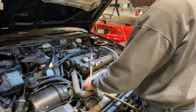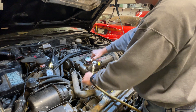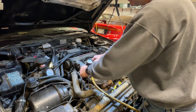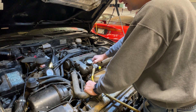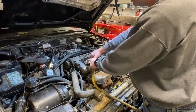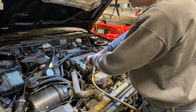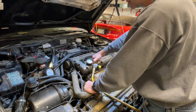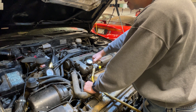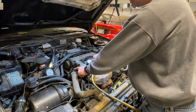Let's do the next one. If I did see even a little leakage, I still want to look in the coolant to see if there are any bubbles — that's an indication of a head gasket issue. Even if you're just on the fringe, you might still get bubbles, because your cylinder pressures are a lot higher once you're actually combusting fuel. There aren't any bubbles right now, but that's something I always check, which is why I've got the coolant reservoir cap off.